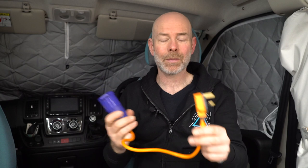Staying with electric hookup — the great thing about a camper van is you can quite often go and stay with friends, especially if they've got a drive, and many will offer to plug you in overnight. You'll need something with a domestic 13 amp plug on one end and a 16 amp socket on the other, so you can plug your camper van's electric cable into your friend's domestic 13 amp supply if they've got a plug in their garage, for example. A huge thank you to my subscriber Willy for bringing me this because I forgot mine.